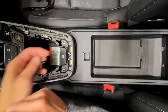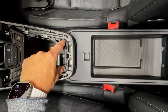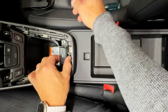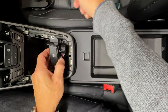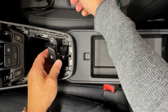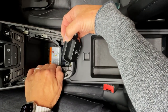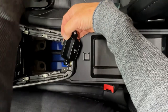Next thing we're going to do is take out the bolts for the e-brake. I've already taken mine out but that's what the T25 Torx is for. Just throw them in that little cubby, and then the e-brake switch comes out — it's just an electronic switch. I would not disconnect it; I would just leave it connected the whole time. Then this cubby base basically just slides back about a quarter of an inch and then lifts straight up.